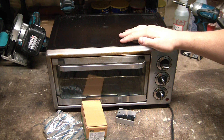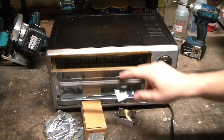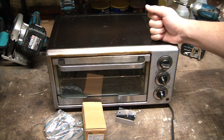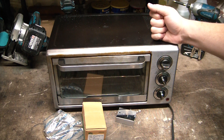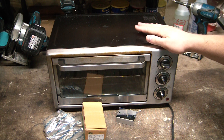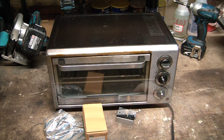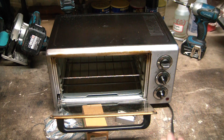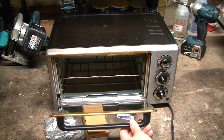What I'm gonna be doing is using this old toaster here to make a tempering oven. We're gonna modify it to go above its typical temperature. I want to be able to bring this thing up to about 700°F, maybe 725. We might have to put some insulating wool in there so there's not too much heat transmittance through into the steel body of the oven.